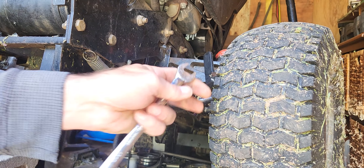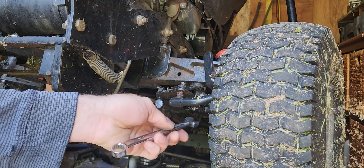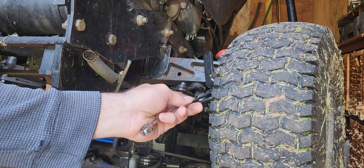I need to leave that in there so you can turn the nut, because otherwise it just turns the wheel. I'm using a 14 millimeter on the nut and a 13 millimeter wrench on the jam nut.